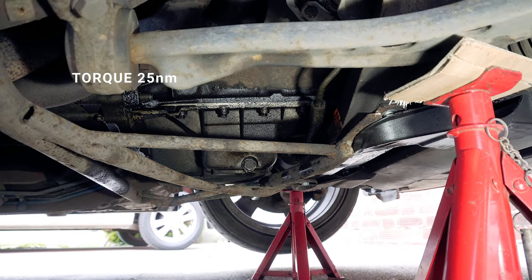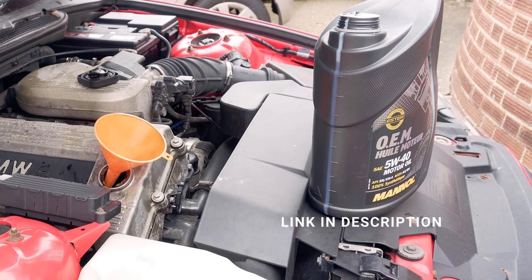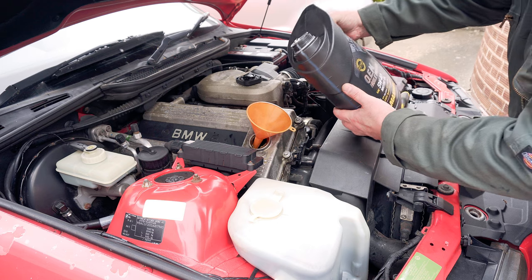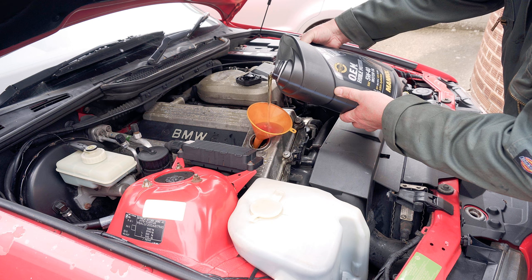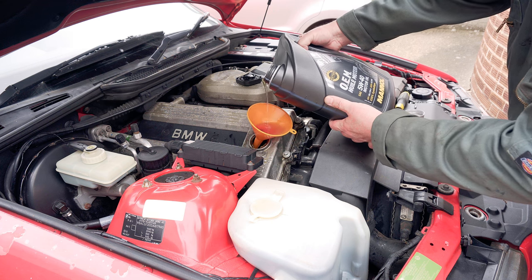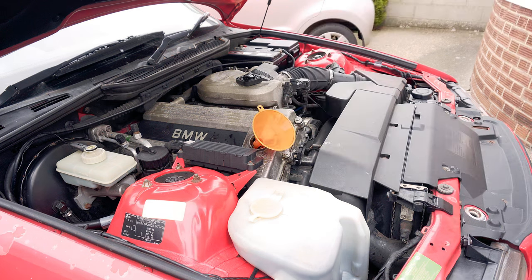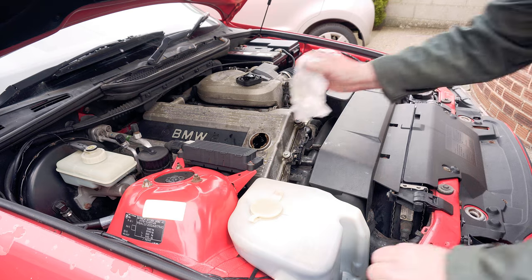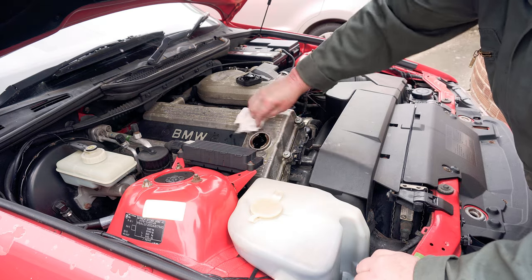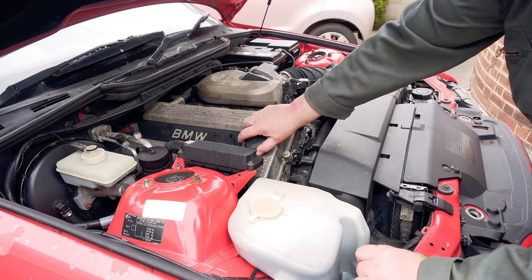Which has you just scrabbling around under the car again. I use the recommended 5W-40 semi-synthetic and have chosen a German brand again. It takes about four and a half to five litres — you could convert that to four and a half to five quarts. What I do is put in about four and a half litres, maybe a little bit under, run the engine for a while and then check it. You can't check it before you've run the engine because you need to fill the oil filter.